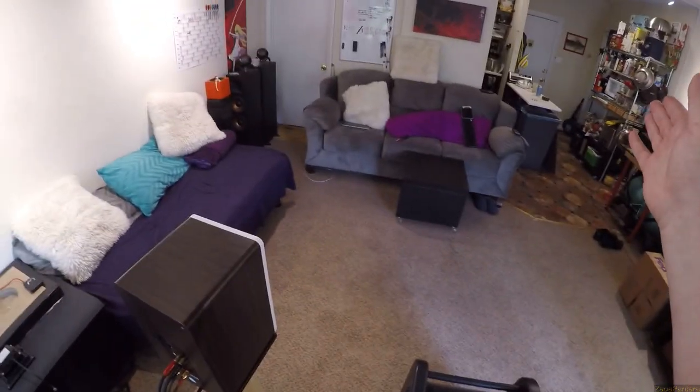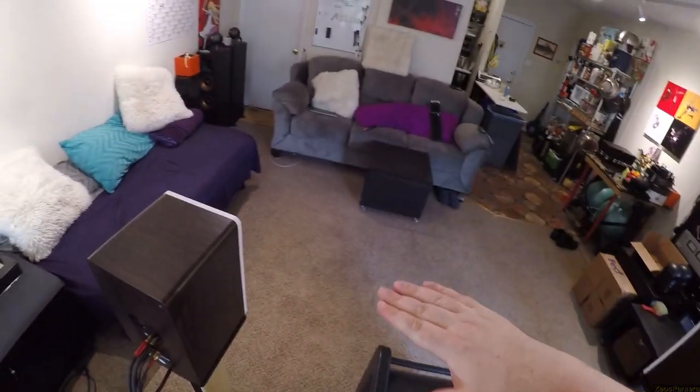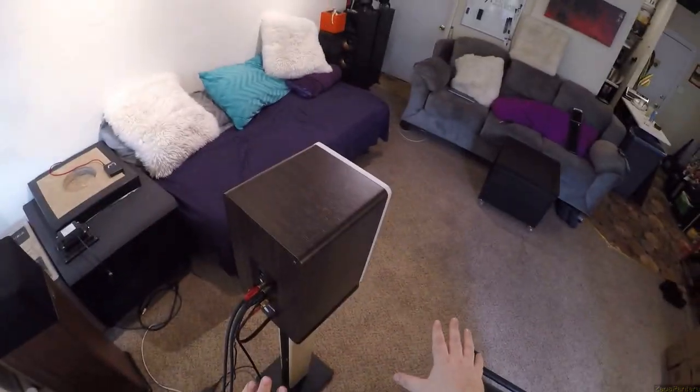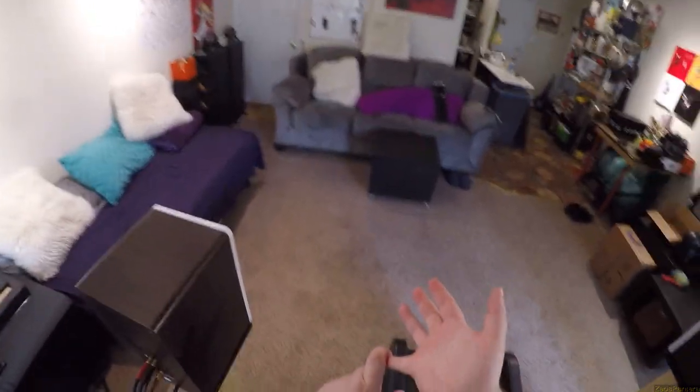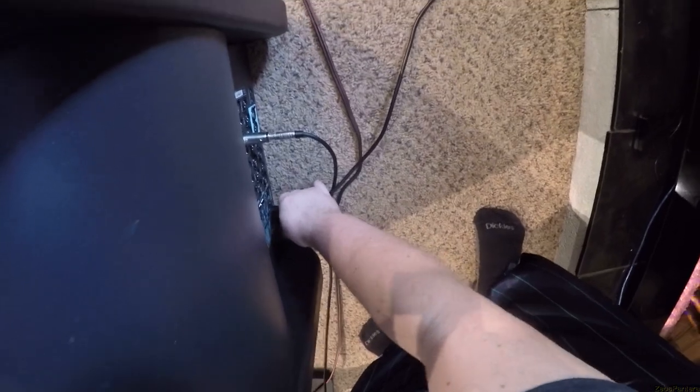The Vanatoo T1 Encores that are in my other apartment, I plug in a subwoofer to those, or a wire to those, and they dim and come back up louder. And then all the bass that was in the speaker is gone, because the DSP inside it says, oh, I sense an RCA has been plugged in. I'm going to remove bass from myself and give it to the subwoofer at this certain frequency range. That's proper. Not many things do proper. And well, neither does this.